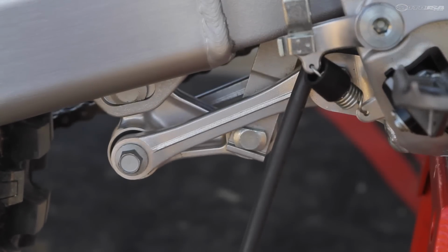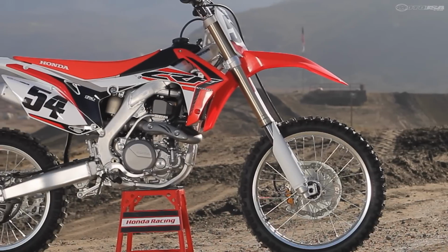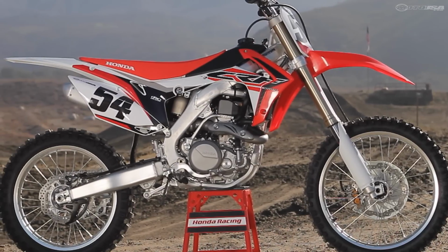The knuckle and pull rods of the shock linkage have also been changed to work in conjunction with the longer front fork and improve rear wheel traction. The fork and shock also receive some revisions to the internal settings to go along with the outer changes.